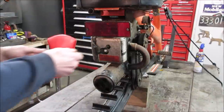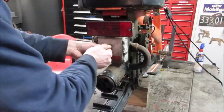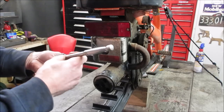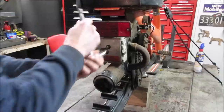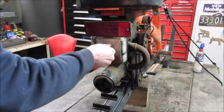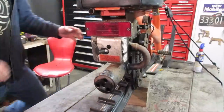When we picked this thing up, it had a broken pull start. It seemed like it was the last thing it got parked for, and it could be from the fact that the decompression wasn't working, and the resistance that it takes to go through that. So we'll go take that out and pull on it right now. It should feel like there's no spark plug in it. Let's see what we get. Yeah, see? It doesn't make any difference whatsoever.